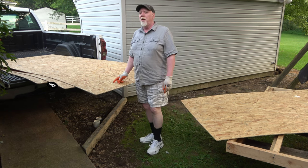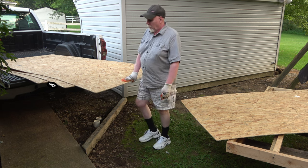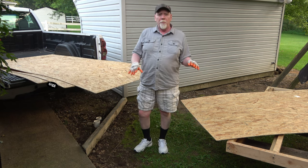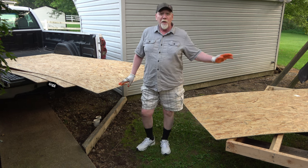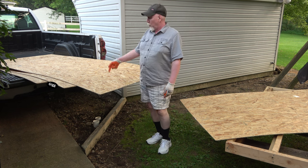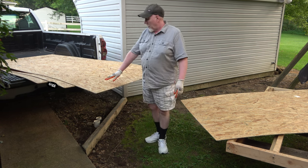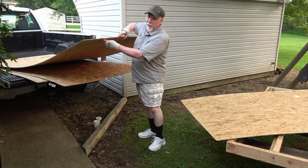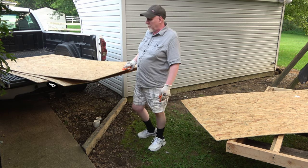Got some 4x8 sheets of OSB board, 1/4 inch thick. Figured I'd use it on the deck, try to keep the trailer lightweight. I just need a skin for the drawers to slide on, and the support will be in the shelving. I'll put the smooth side up, and then I'll paint the bottom with deck paint for moisture protection.